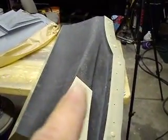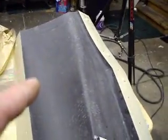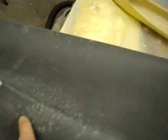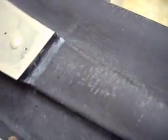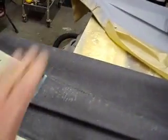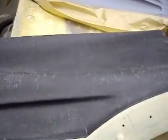What I'm going to do today is get all my carbon and paint it on here. That is two layers of carbon and a layer of fiberglass. Man, that's going to be one sturdy tail section. And we did allow for our carbon skins. When I test fit that bulkhead the other day, remember I took that razor blade and slid under there? There was just about a sixteenth of an inch gap everywhere. I test fit it again last night and it's just perfect with that skin on there — a perfect fit. It's ready to go.